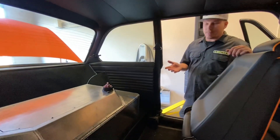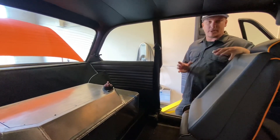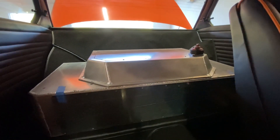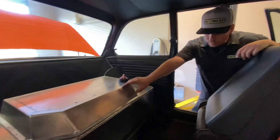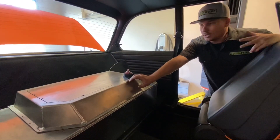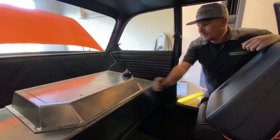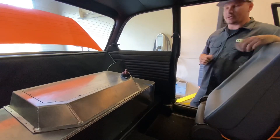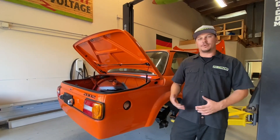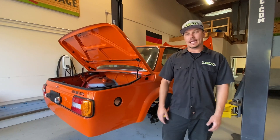This is going to be our rear battery box. We already have this one figured out sizing and dimension-wise, so we already have it built out of aluminum. It's going to house the six LG Chem battery modules in the bottom, and in the top we're going to hold all the components that go in the contactor box — such as fuses, contactors — and it's going to have all the battery management solution stuff mounted inside, as well as safety switches and all the other components. We haven't quite figured out where we're going to put the charger, but as far as the charge inlet goes, we're still going to try to make it fit into the stock gas cap location.